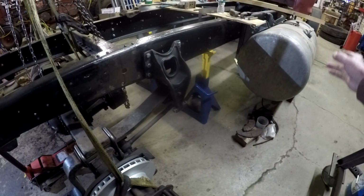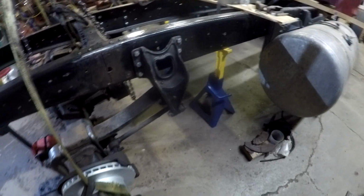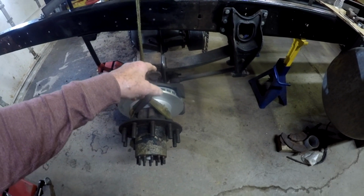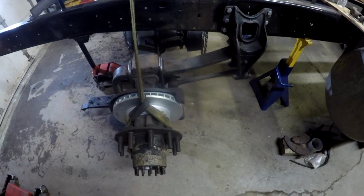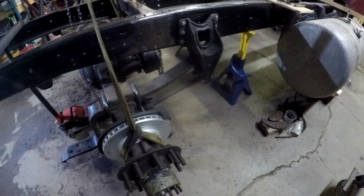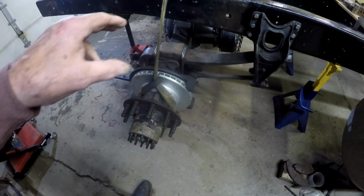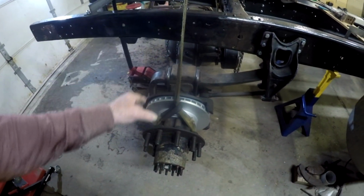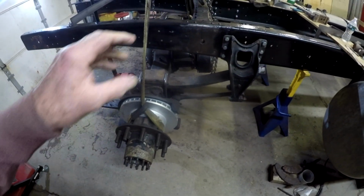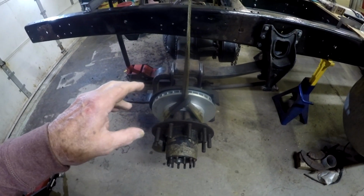Now, I told you how I measured off the front axle to position the brackets for the suspension on there, and I did that. But now that I've got the axle positioned or up in place and clamped down, what I want to do is pull a measurement back off of that front axle, back to this rear axle, and make sure that it is sitting parallel to the front axle. So before I start messing with the brake calipers to see if I can rotate them things around, I'm going to do that. And again, that will be in the next video.